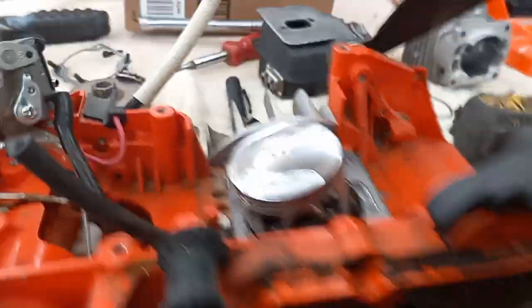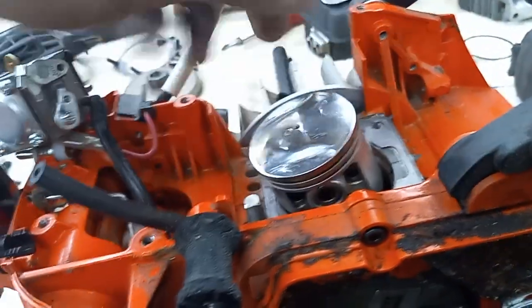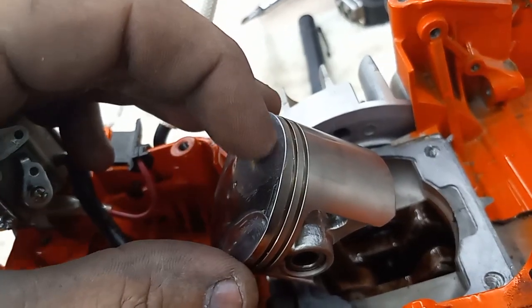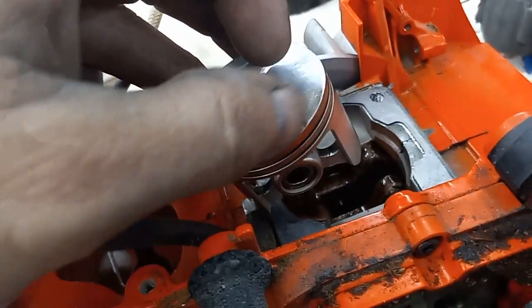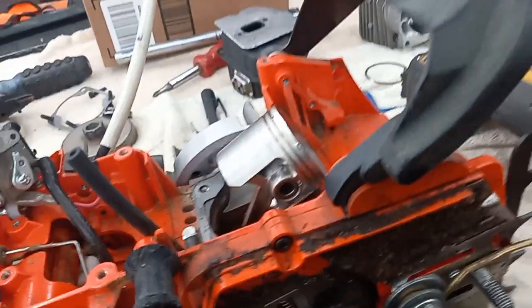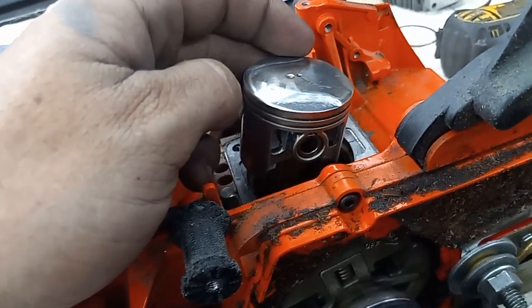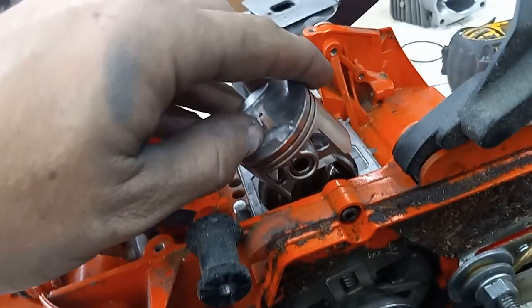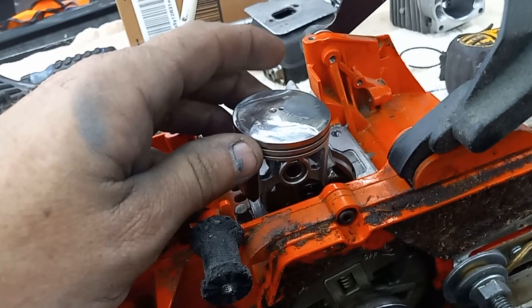I'll show you the piston work. It's ugly, but don't worry about that — this is all testing phase, I didn't even get all the scratches out. I had to do this pretty crudely, but I set my exhaust timing the rest of the way here, and right here is the rest of my transfer timing. I didn't do anything to the intake. I will give out the blowdown — it's 26 degrees blowdown. It looks steeper in here because I started cutting into the dome; I cleared a path, I wanted a little extra flow out of my transfers.